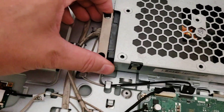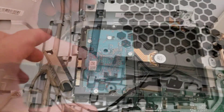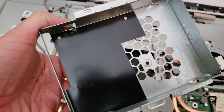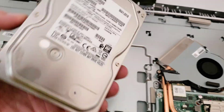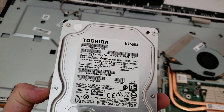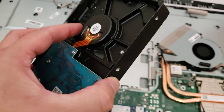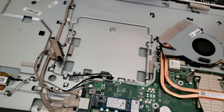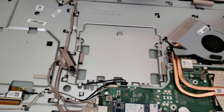I've got that out now. I'll pop the SATA connector off — there we go, SATA connector off, housing came right off. There's the hard drive — it's a single platter so it's very light. I'm going to substitute in an SSD.